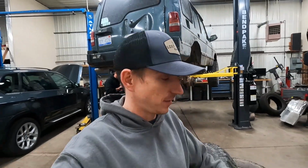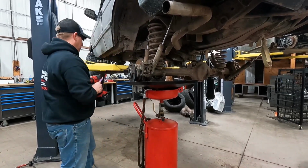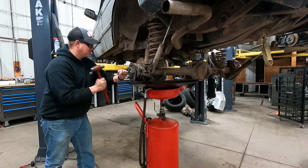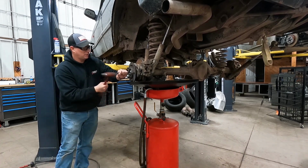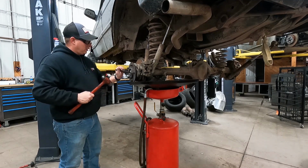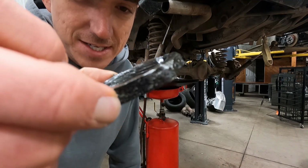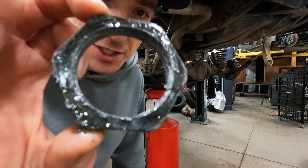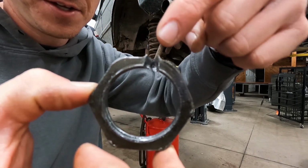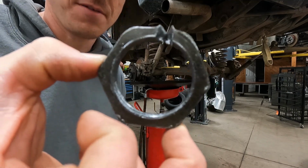So the nut is stuck on there. Ted's going to physically remove it with force. It's gonna break the budget on this, so we'll have to get a new nut. There goes a bit. So you might be able to see there that nut is pretty junked. What he did was drill in there and then use a chisel so he could split it, and that spreads it so it can just slide off. Trying to save the spindle.